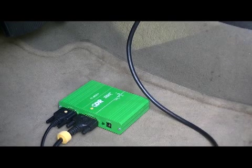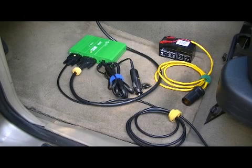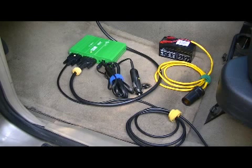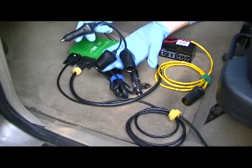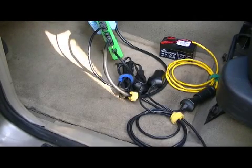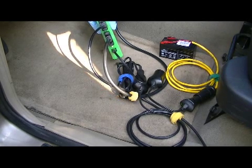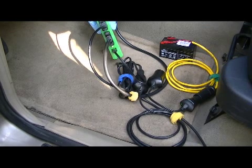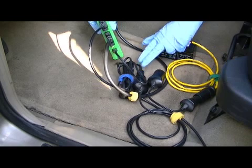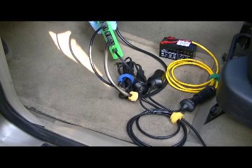This means I am going to need to supply a source of power for the repowering rig and the CDR interface module. Remember, I always need to make sure that I use the same source of power for both the CDR interface module and the ACM. In this case, I am going to use a Y adapter or multiple receptacle adapter. I am using one source of power — either a booster pack or in this case a smaller 12 volt rechargeable battery. I am also grounded to my vehicle chassis through my repowering rig. I have the CDR interface module connected to my Y adapter and, as you can see, I now have a green light on the interface module indicating power. This allows me to test the interface connection if needed.